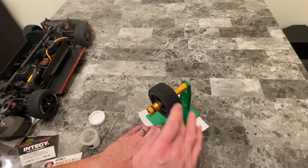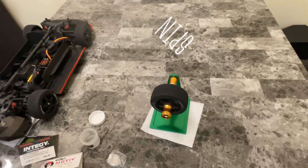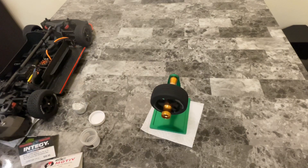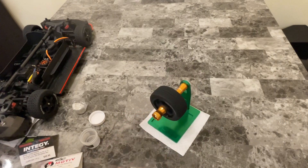We're going to spin it again and see if it continues to roll and then comes to a dead stop — that means it's completely balanced. But if it keeps turning a little bit and then rolls back, it's still off. That's pretty good, but I want to spin it a little bit more. If it does that again and completely stops, then I hit it right on the money.